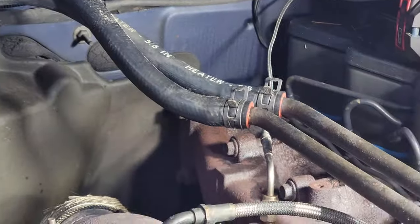My solution is to mount the Webasto controller here to the left of the brake release. For now I've just taped it and I'll get the wiring harness sorted out. I designed a bracket and had it cut using a service called SendCutSend — this is going to be for the Webasto controller. It lines up perfectly; I just need some hardware to mount the controller to this bracket. It's going to mount through the brake release screw, and I added a couple holes to bolt it in at the bottom. I just need to drill one additional hole on this side, get hardware mounted, and then it'll be pointing at the driver when sitting in the driver's seat.